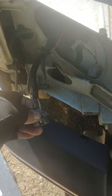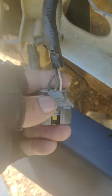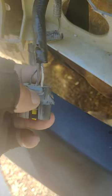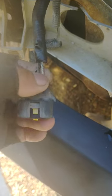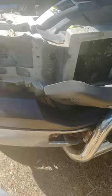Anyway, I hope that helps. You've got your skinny black wire here — this wire is actually smaller than the two to the right — so this is your ground. The center is your running light, and then the one on the far end is your turn signal.